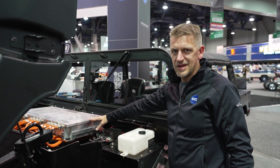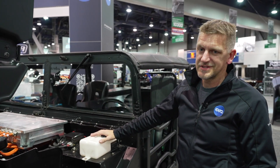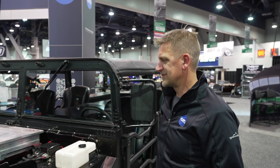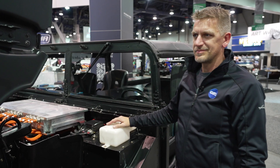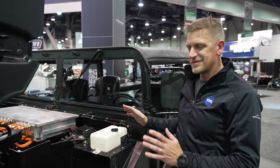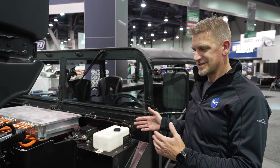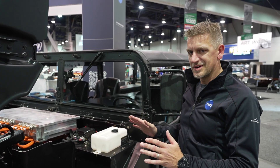This is the heavy-duty X-Ro traction inverter. It's designed for a Class 8 truck, so it's got plenty of power and torque for this vehicle — actually way overkill. It's got roughly 4,000 newton meters of torque and about 900 kilowatts of electrical power, which is way more than enough. We can actually hurt this vehicle — we've broken axles and an A-arm before — so we have software limits in place to make sure everything stays together.